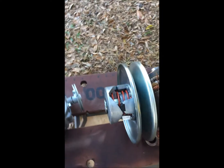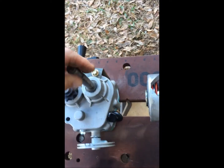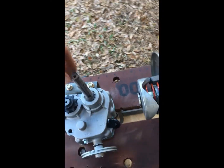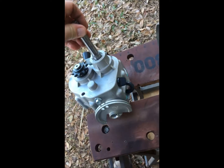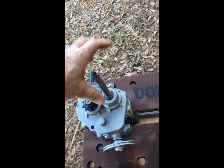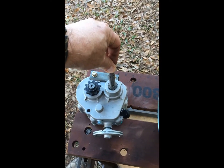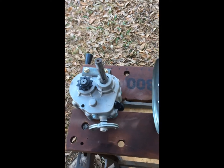I've seen a few guys do this conversion before. One guy actually machined a groove in here just like I have, and I was going to do it his way but found a different way. I had to machine this groove into the transmission so the torque converter would slide down the shaft, but I didn't like the way it hung out on the end — there's a lot of weight on only a 5/8-inch shaft. I figured putting the torque of a 16 horsepower engine on that wasn't going to be sufficient and I'd end up bending or breaking it off.